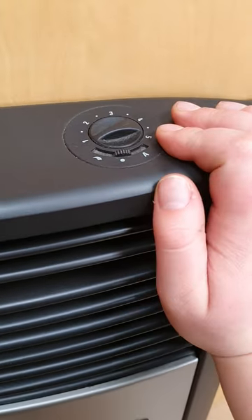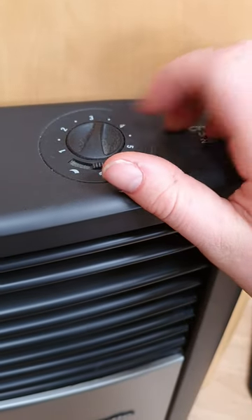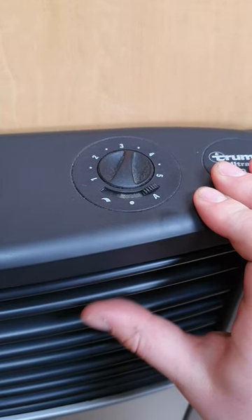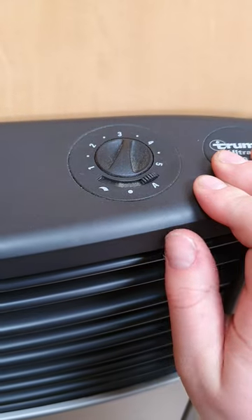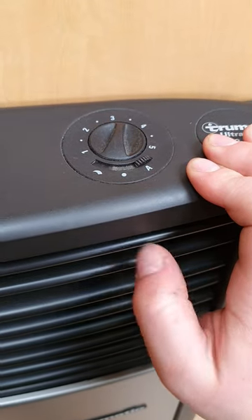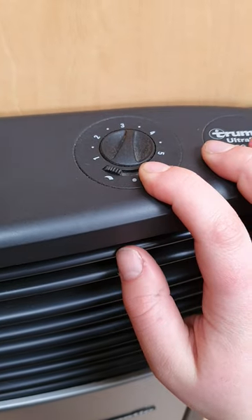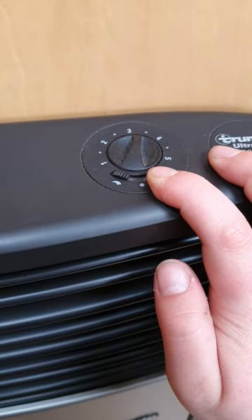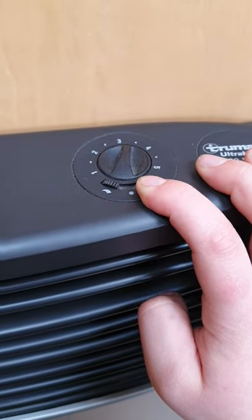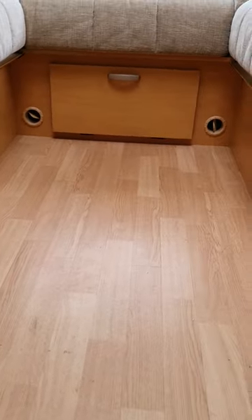This here is your room heater unit. Up on the right hand side is for your 12 volt fan. The little circle in the middle is off. Up the top, 1 to 5 is your fan speed. On the right hand side, A is automatic — there are some temperature sensors inside the heater and it will automatically kick the fan in and out to maintain the temperature you've selected on either gas or 240 volt. On the left hand side is continuous, so you can run the fan when you're using the heater on gas or 240 volt to circulate hot or warm air, or you can run the fan on its own and it will circulate room temperature air. When the fan is on it circulates the heat through the little ducts in and around the van.